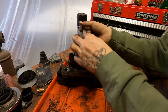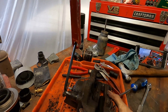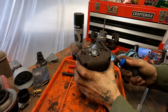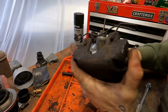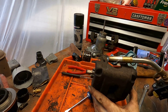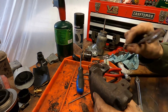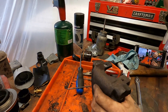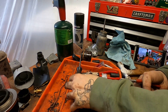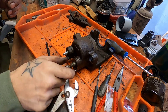I'm going to be dealing with seized pistons in just a minute. But whatever your issue is, before you move forward, make sure your caliper is 10 out of 10. Once you have done that, you can start disassembling — breaking this caliper down to its most basic form by removing the slide hardware. In this case it was 7mm hex Allen. You're also going to want to remove any other hardware, anti-rattle clips, retaining clips. One side of my anti-rattle clip is seized, so I'll use the torch to get it hot. If you're reusing a spring clip, don't get it cherry red or you'll ruin the spring characteristics. Pull out all the rubber — even if it looks decent, it's got 20-some odd years on it, and the new kit comes with replacements, so why wouldn't you?